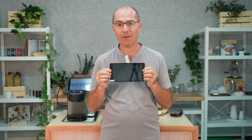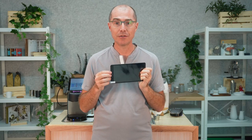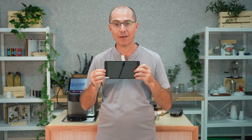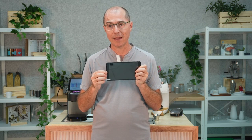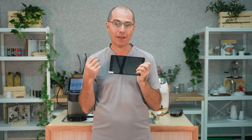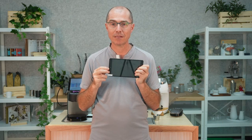This is a tablet made by Pipo — it's an 8-inch tablet that comes in Android 5.1 and Android 8 versions. For the first five years of Decent Espresso's life, this is what came with the machine. Because the Decent is always keeping the tablet on full charge and Android doesn't have smart charging, these batteries die after 3, 4, or 5 years — sometimes as little as 2. When that happens, we've been simply replacing the tablets. It turns out we can take the battery out of the loop and wire them directly into USB to give them new life. The battery-free kit we make for the Teclast tablets also works fine for the Pipo tablets, just a little bit differently.